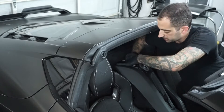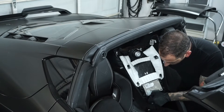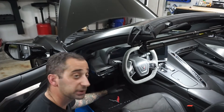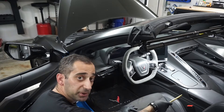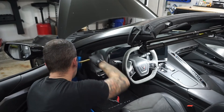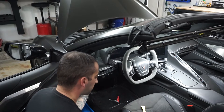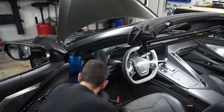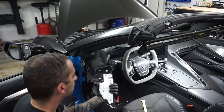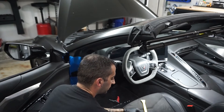Disconnect the top speaker and the bottom wireless charging connector. There's a little red retainer on each — slide the retainer down, then press the black tab and it comes right out. Next, you want to get out this panel here. To do that, first take out a couple of trim pieces. This small panel here just uses a plastic trim tool — two clips, pops right up. Then the next panel: slide the trim tool in, work your fingers in to create a gap, and it'll pry right out. This one has six clips total — one, two, three, four, five, six. You have to line up all six when putting it back.